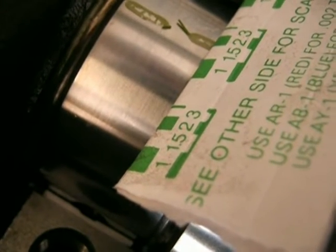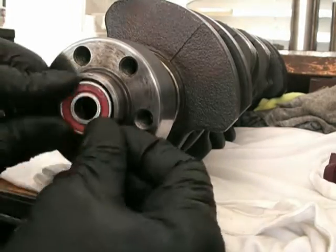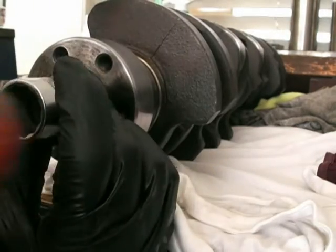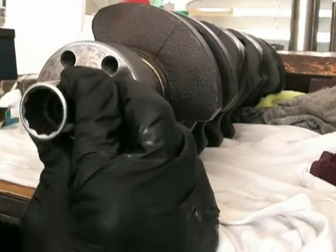You line the widths up with your plastigauge — it's a bit hard to see in this photo, but it's actually 2 thou, which I'm happy with. I think that's fine.